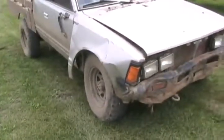But here's the problem. The reason it's sitting down so low on that side is this has torsion bar front suspension because it's four-wheel drive. And it's missing a torsion bar. You see way back there — that's a piece of a torsion bar that's broke off.